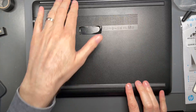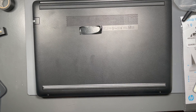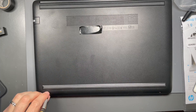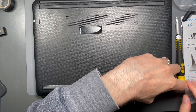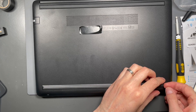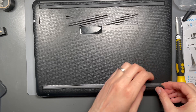Let's get the back off of this. There are two strips on here that cover up hidden screws, and what's nice is that they're all Phillips. I'm going to remove the two screws on the front first. For these rubber strips, they are adhesive down. I've taken this apart once already, so they might be easier to come off a second time, but if you're not careful, it's pretty easy to tear these. The whole thing is just to go as slow as you possibly can.